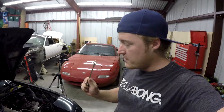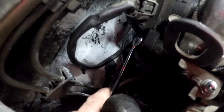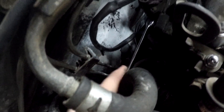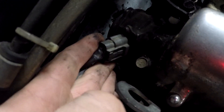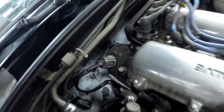Now get your 12 millimeter wrench and come over to the cam angle sensor. It's worth noting that this is for the 1.6 cars. If you're working on a 1.8 car, the cam sensor is actually on the other side and you're going to need a socket wrench to go down the backside of the head to get to it. But even just from looking at this it should show you where to look — right on the backside of the motor. There is a bolt right there and we need to break that loose. Get a couple of turns on it so it's easy to turn the cam angle sensor. Now that it's loose, you can bring your hand down and spin it left and right — that's actually how you adjust the ignition timing on this car.